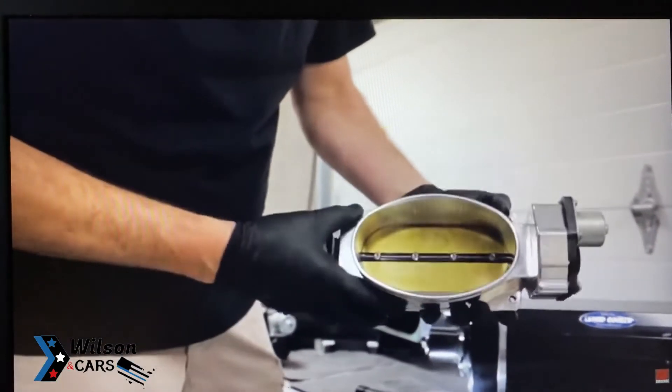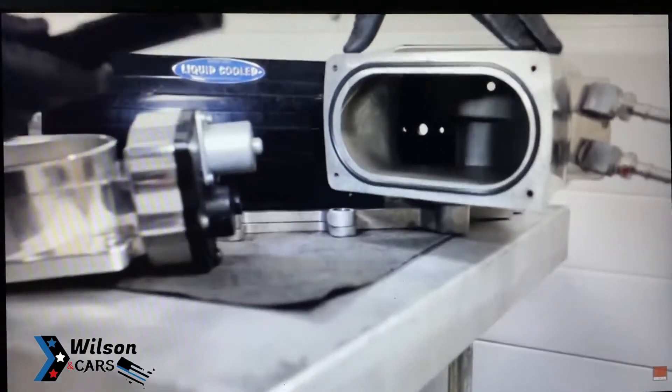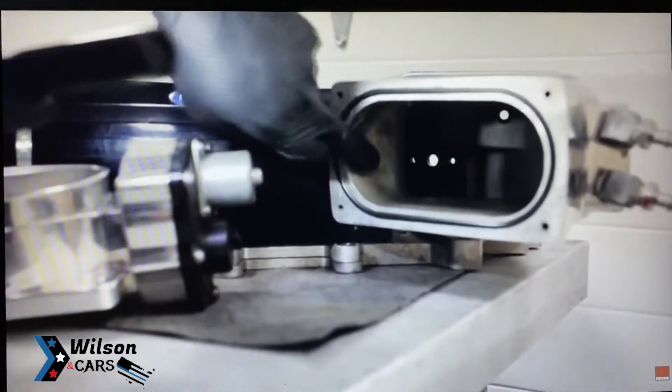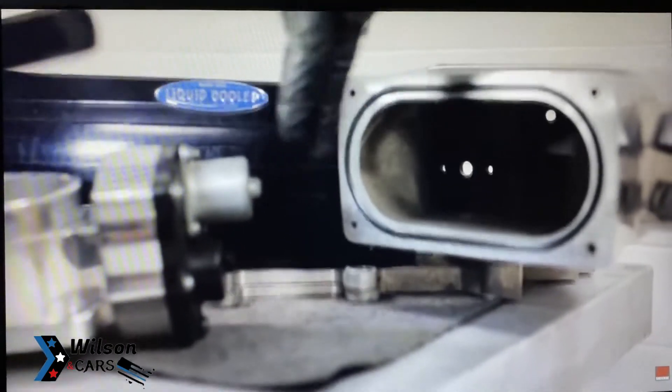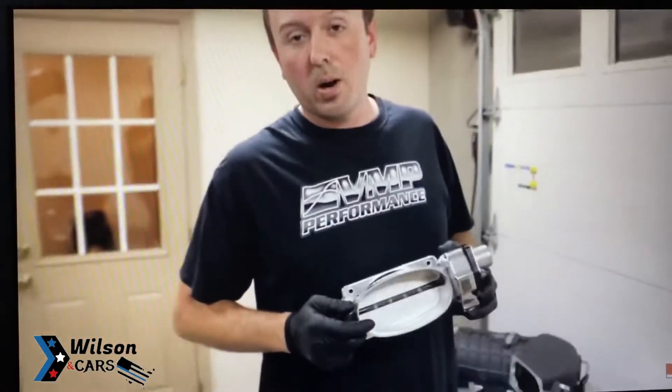This system uses a 168-millimeter throttle body, but 168 is misleading because it's just the width, not the height or any combination. VMP moved away from calling throttle bodies by millimeter size for single blades, instead using square inches. This throttle body is 17.7 square inches; the VMP 163R is 16.3 square inches — they went slightly smaller for a specific reason: with a large opening and a hairpin turn into the rotors, a good percentage of the opening gets obstructed, so the 163R was sized to provide good airflow without being problematic to tune.